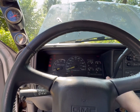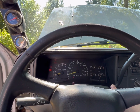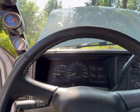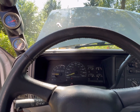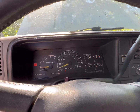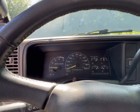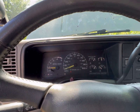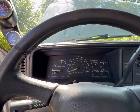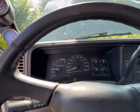We'll see what Casper does since it's been sitting since Saturday. Cue the fun music while the glow plug light goes. And that's that — that's how your truck should start. My volt gauge does pull down when the glow plugs come on, just like they all do, but as soon as it stops the afterglow cycle it'll pop right back to 14 volts. Make sure that the plug on the end of the alternator is in good shape, and also make sure the stud on the alternator is in good shape. I've got a new alternator in this that I did last spring, which definitely helped.